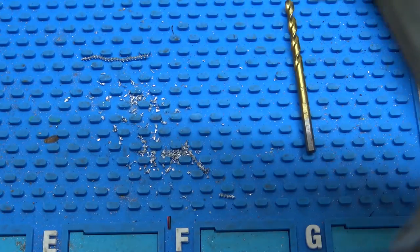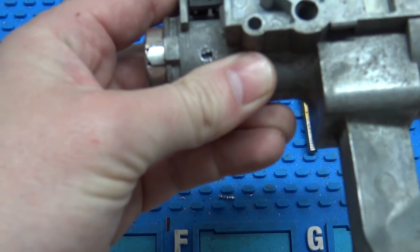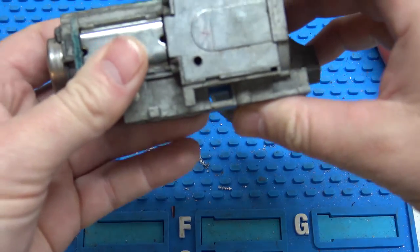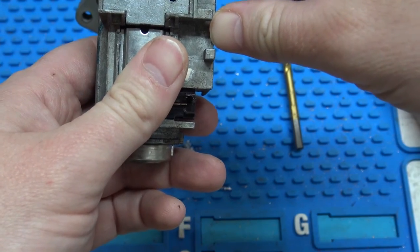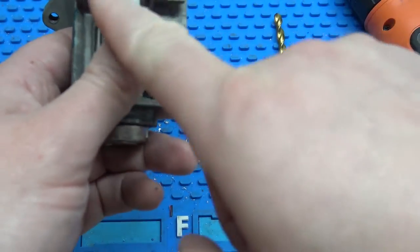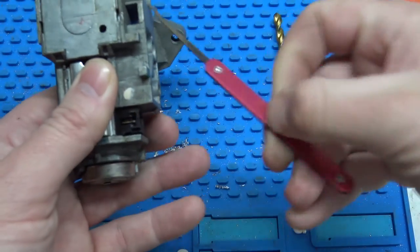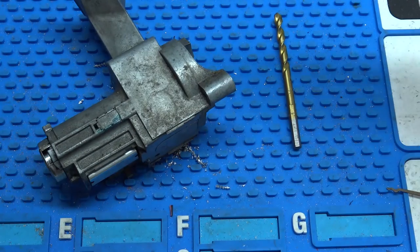Alright, so there's our hole, and you can actually see the sidebar in there — probably won't be visible on camera — but you can put pressure on it to be able to pick it. And the other thing you need to do too: here's your hole to go in and eject it. The way these work, you don't push straight down — it has to be turned a couple degrees, and then you have to actually push, and the retainer is on the side over here, so you have to kind of go down and then to the left to get it out. Something like this works pretty good, but it also helps to make that hole a little bit bigger.